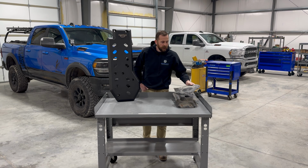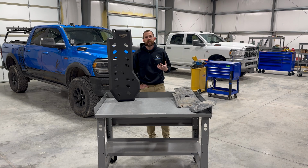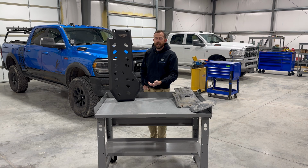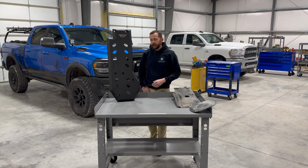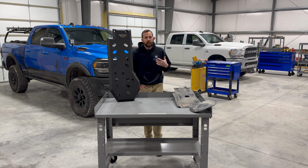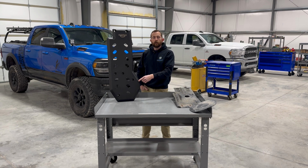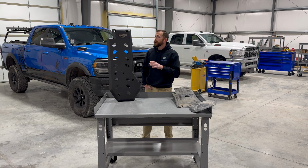That is not a skid plate. What we have to do, just being honest about the structure that's required to protect these heavy chassis, is that we have to offer standoff distance. And so what we have here, in addition to a very robust skid plate made out of 3/16 plate steel with all corners welded fully and internal geometry added, is that we've also incorporated 1.5 inches of standoff distance. If you crush this on a rock or something else on a trail, this can deform some without ever touching the DEF pump. That is the protection that we need. So that's what we've offered here.